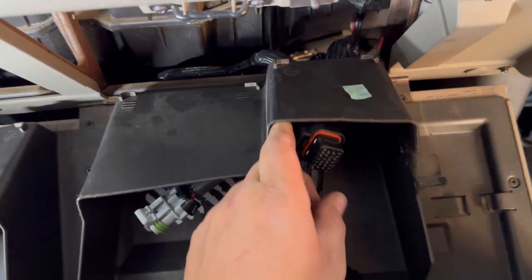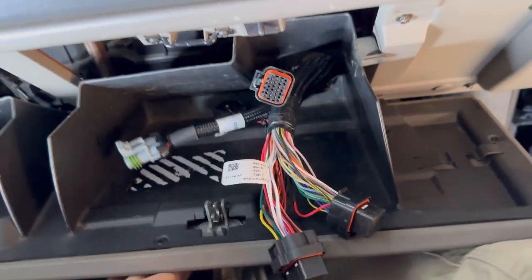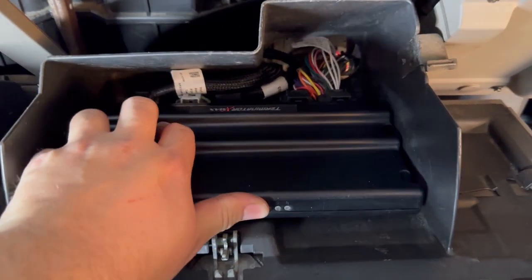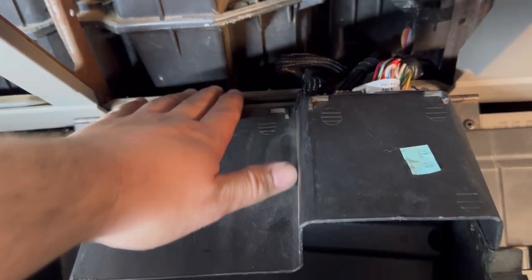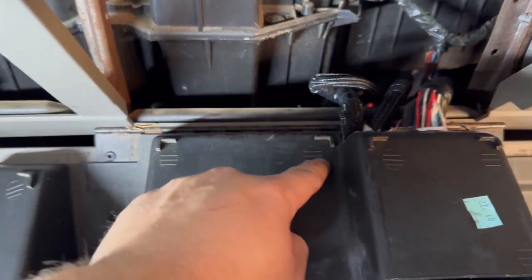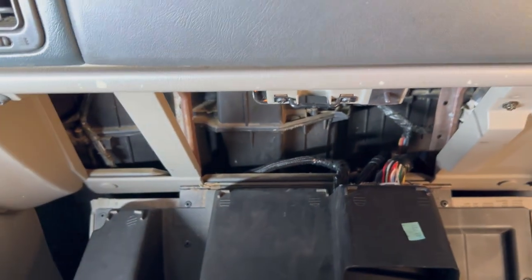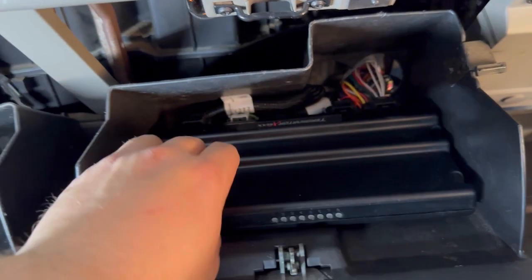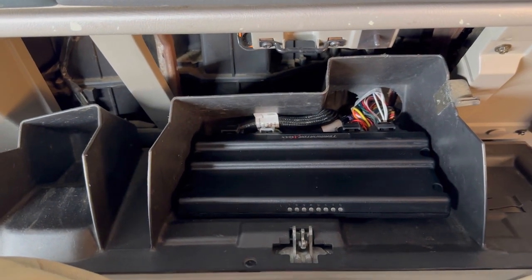Back in the cab, I do have everything ran in. It's got the transmission harness, the main harness, and the main power. It looks like all I need to do is really plug it in. I feel like I need to state that it is a little tight trying to get this in there when you get all the wires on the back of it. I may need to drill some holes back here, but I am limited by the airbox. I could probably expand out in this area — just take a Dremel or something and cut this out. It is tight, but I think it's going to be good. I've got some Velcro coming, and I'm probably going to have to glue a piece of nylon down just to raise it up a little bit, because with the wires on the back it doesn't want to sit flat. But other than that, I'm pretty happy with it.